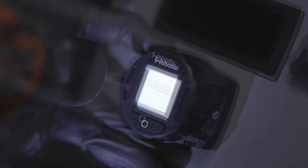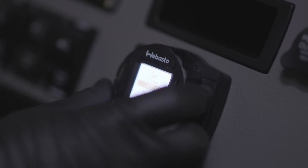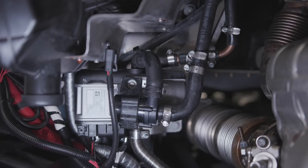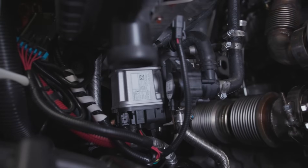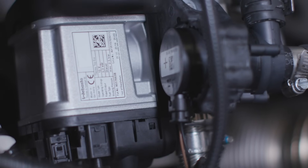For a first time setup, you'll need to set the date and time on the SmartTemp control FX 2.0. To manually start the system, turn the heater on with the SmartTemp control by pressing the Webasto button. Depending on the length of the fuel line, you might need multiple starts to prime the system. You'll hear a continuous clicking from the fuel pump as it starts to prime, and once primed, you'll hear the ignition through the exhaust pipe.